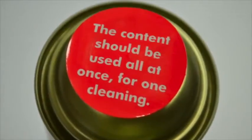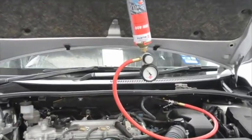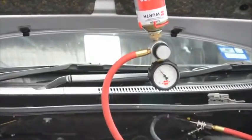The can is suitable for a single vehicle application. The LBW400 aerosol will now remove all traces of oil, grease and carbon residue from the fuel intake system. As the cleaning fluid is delivered by the vehicle's own injection system, the cleaning progress is targeted toward the components of the engine that will directly benefit.